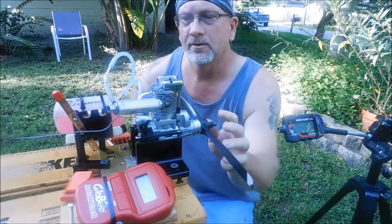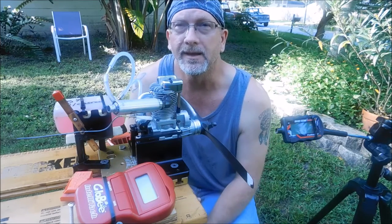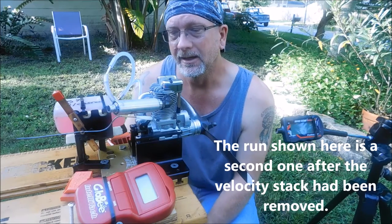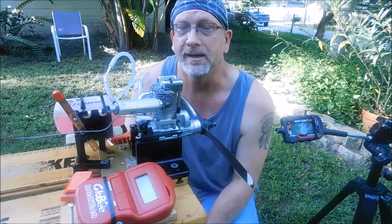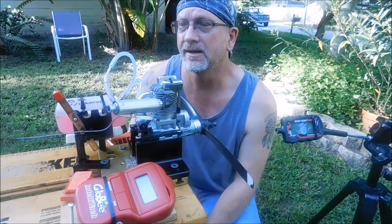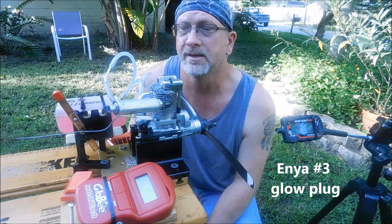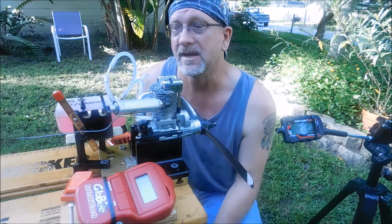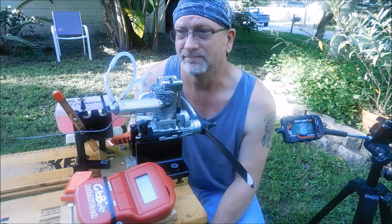Good morning. So, after the last few days and weeks of running fuels that I've never run before, namely the Omega FAI 0%, and believe it or not, I've never run 5% nitro either, I've decided to pull out a couple of my largest four-stroke engines, that being a Saito FA-80 and a FA-91S. And I've got some 5% Omega here that I've added castor oil to bring it up to a total lube content of 20%. So I just wanted to give these two engines a run just for the heck of it and see how they did with this fuel, and then maybe if they run okay, maybe even try the FAI fuel on them, just as a cost savings means.